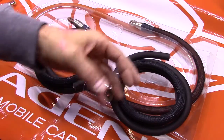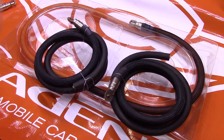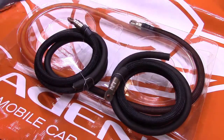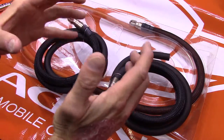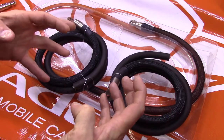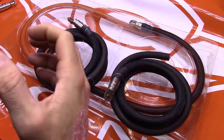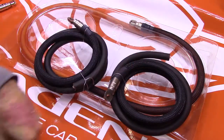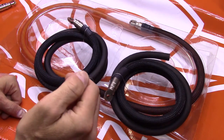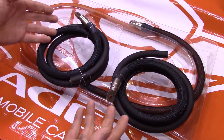The problem is, if we add a big stereo system in the back — say we throw a 1,000-watt amplifier in there — we're going to tag the car's body for the ground source in the back of the car, because that's the easiest thing to do rather than run two power cables to the back. Now when we get to the front, the battery is our storage medium. It has anywhere like 800 to 1,000 cold-cranking amps, so for very brief moments we can have the current we need on demand. The problem is that little 8-gauge cable cannot flow the current necessary from the battery to our amplifier in the back.